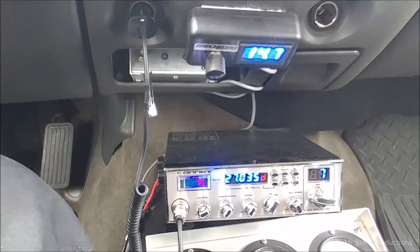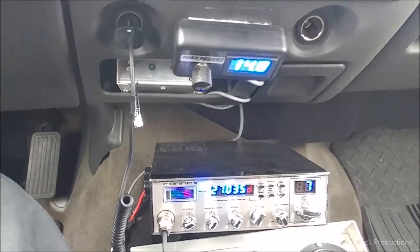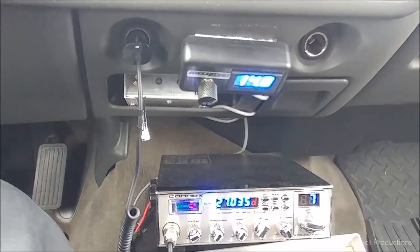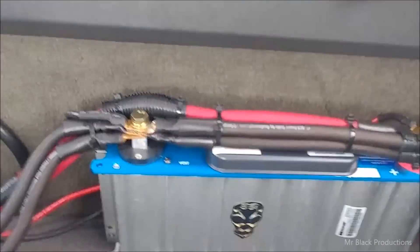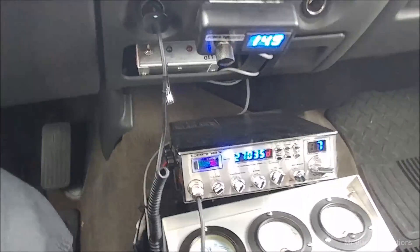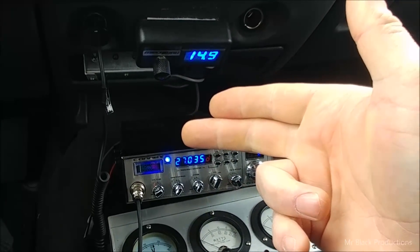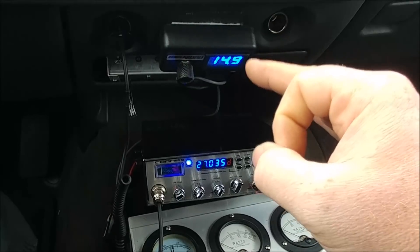The batteries don't do you any good until you get to 12.5 volts. If you've got some 6s and 8s and put them together to get a different voltage, you're running off the capacity of the batteries — you're doing the same thing. It's about storage, weight, size, and safety. They rate the capacitors in millions of cycles all the way down to fully discharged. After talking with the guys at Maxwell Capacitor themselves, they say they rate the thing in billions of cycles. You don't have to worry about the capacitor freezing, venting hydrogen gas, or the connections corroding. It is a static device that requires zero maintenance.